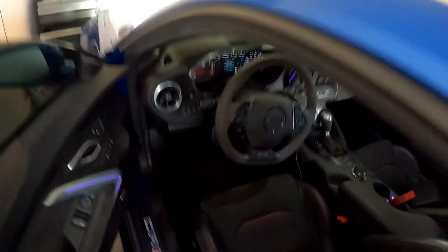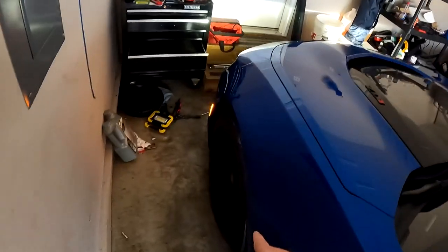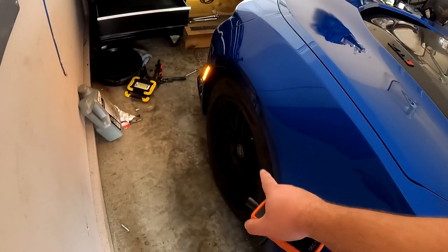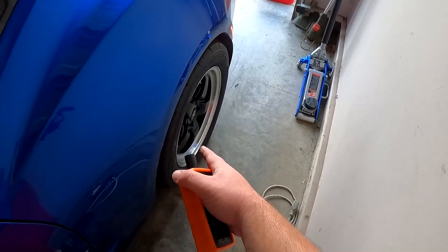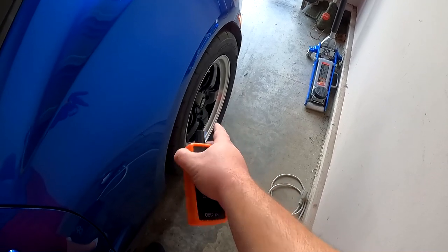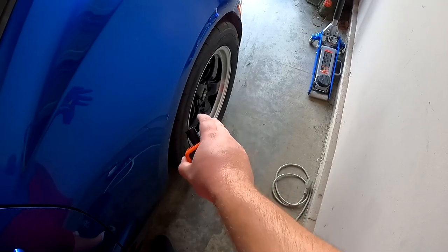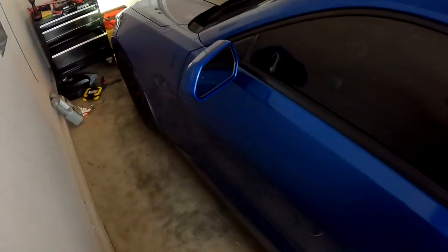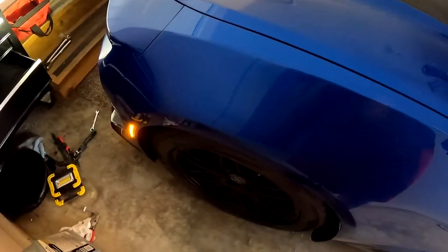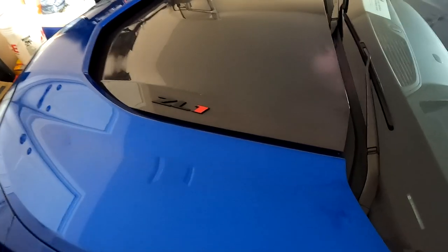One last thing I advise — especially if you're running light fronts like I am, almost like front runners. I'm going to have these fronts at probably 38 PSI, and the rears for drag racing at like 18 PSI. But for street, I'll have the rears at about 26 cold, and they heat up to 28 — or even 24-25 cold, heating up to 26-27. There you go — I hope you enjoyed the video, I hope you like the wheels. Subscribe for more ZL1 and fast car content. That's it — I'll see you guys in the next one.